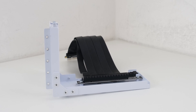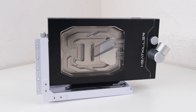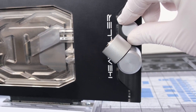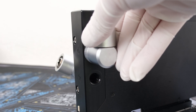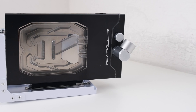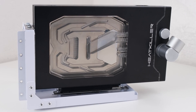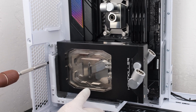The Lian Li Vertical GPU mount is used to better showcase the flow path. On the front of the GPU block, let's drop in a 90 degree torque adapter, an Optimus compression fitting, and an EK Quantum plug. On the back, we'll add another 90 degree adapter, a compression fitting, and an Optimus plug. The water block was designed so that screws and electrical components of the board are not visible, and the connection threads are integrated into the terminal so the block can better appear as a single cohesive unit. Now we can insert the riser cable and secure the vertical mount to the case with 5 Phillips head thumb screws.